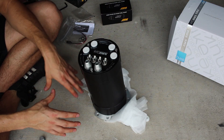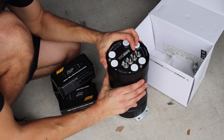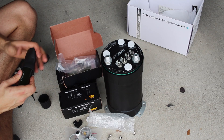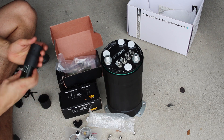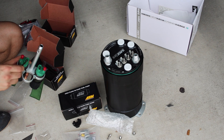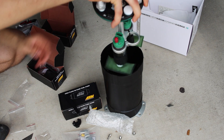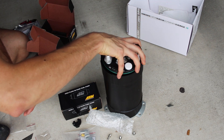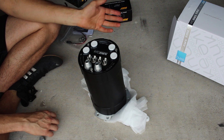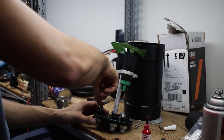There are a couple of benefits of running a surge tank like this. With a standard fuel tank when you're driving, the fuel can be sloshing around and it could get low enough to the point where your fuel pump is actually picking up air instead of fuel, and then it's pumping air through the lines. You have rapid changes in fuel pressure and sometimes you even lose fuel at your rail — which can have really bad effects if you're drifting, on track, autocross, or even spirited driving. If you're in a hard corner and your fuel pressure suddenly drops, you could lean out the motor.